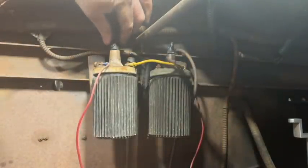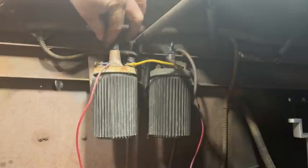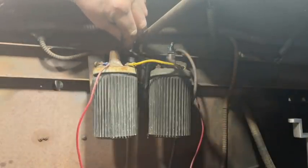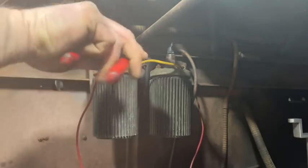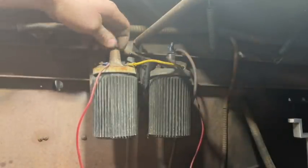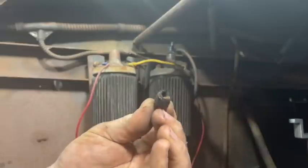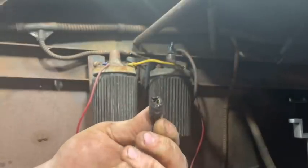All right, so these are the ignition coils for the engine here, and these have the same threaded end in here as the spark plug connectors, but somebody's got some electrical tape, so we're gonna find out what's going on here. These actually thread in just like the distributor caps. They have a thread here and a little contactor on the end, and this is something that can be reused, so we're gonna clean this all up. Same thing over here. This one's loose.